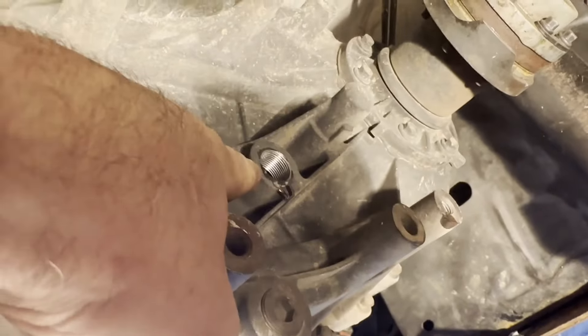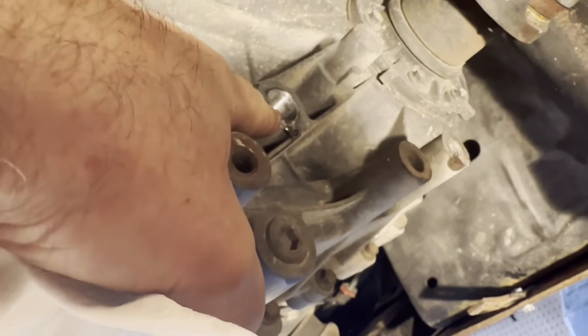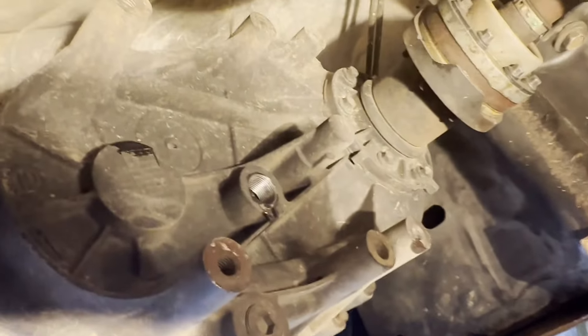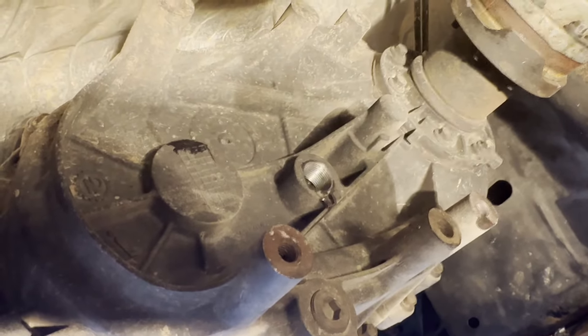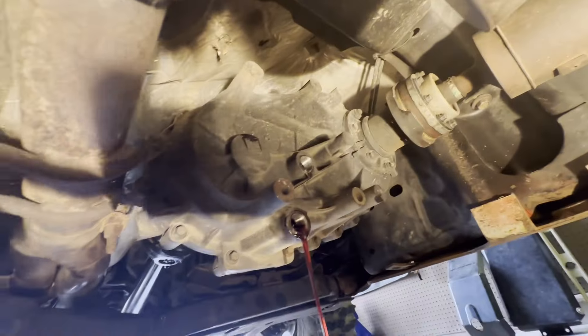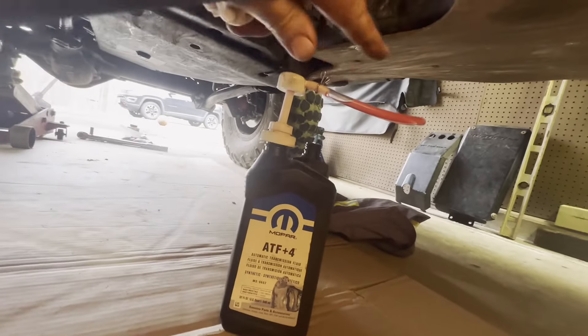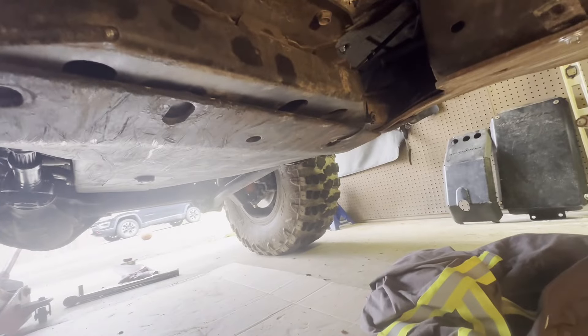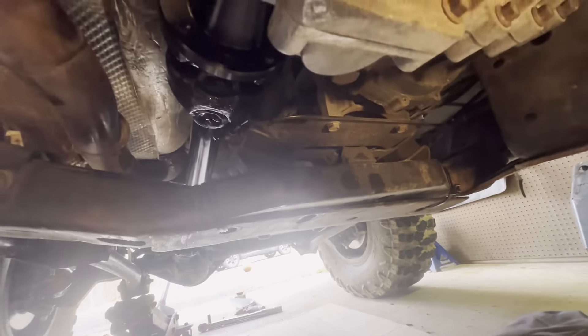To drain, you just take the fill plug off, then the drain plug. About a knuckle in I could feel the fluid. I'm draining it into the oil pan and I have a nice pump to pump some new ATF+4 in. Two quarts of ATF+4 — right when I got to the end, she just started oozing out of the fill plug at the top, so that's great. I'll document all this in my book on the Jeep. The front drive shaft is all set. I just need to cut a couple tie wraps holding up the belly armor and put the transfer case skid plate back on.